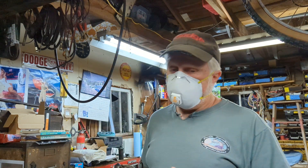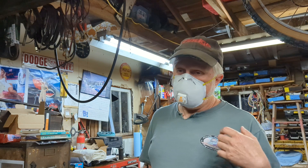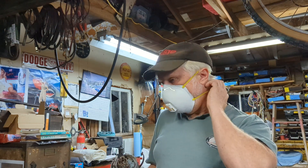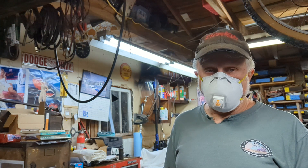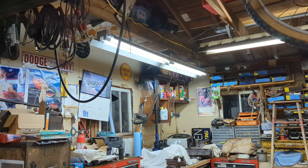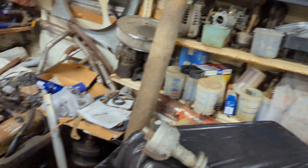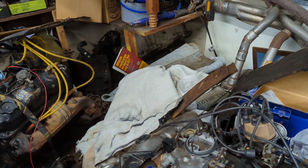Those computers are not set up for any kind of performance really. If you want dual exhaust, maybe a cold air intake, that's probably okay. But if you want to go with a bigger cam or a different intake manifold, pretty well forget it. The viewer posing the question said his '87 318 will crank over but will not start.